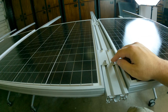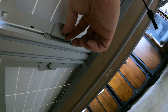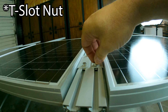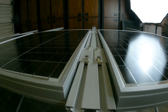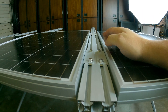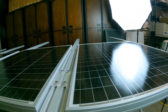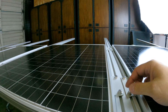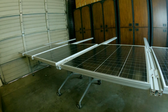Everything up here is stainless — stainless bolts with a washer, another washer, and a nylon locking nut. The only thing I couldn't get in stainless was the T-slot hardware — I got that in nickel-plated steel. In the final assembly, all of these are going to have Loctite and be really torqued down. Anytime you can use nylon locking nuts on a vehicle that vibrates, definitely go with that. Since I couldn't get that one piece in nylon locking nut, I'll use Loctite on it.